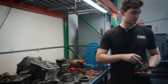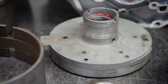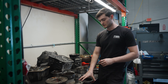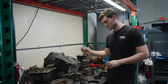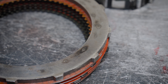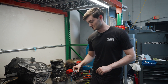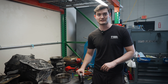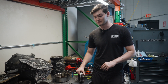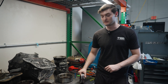So that is most of the issues that we found in this thing. The biggest problems are: everything is dirty, he used wheel bearing grease to assemble this thing, used parts, not checking clutch clearances, reusing damaged and rusty parts, not replacing parts that need replacing. We're going to get this trans back together in working condition for this guy. When you guys are looking for a transmission shop, this is not the quality you're looking for. You are looking for somebody who is transparent, somebody who will tell you and show you exactly what is going into your trans, so that you know the quality of parts and service you are getting. This is not that — this is lackluster. But we're going to get this guy fixed up, put his trans back together, and get him back on the road. Thank you guys.